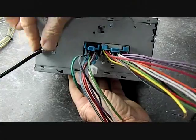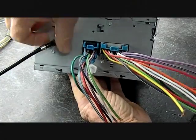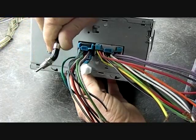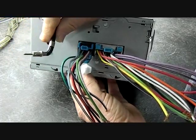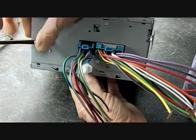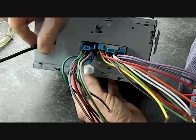We have the main antenna that will be coming out of the dash. Just grasp the base of it and remove it. For aftermarket, you're going to need an antenna adapter to go in place of this to mate to it. If you're putting the original back, it's just a push into place and it locks in.